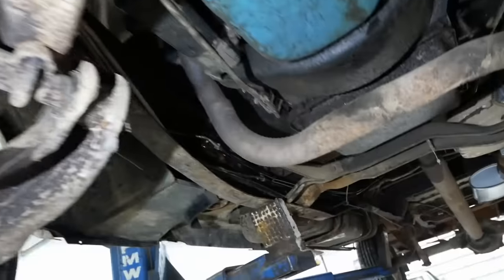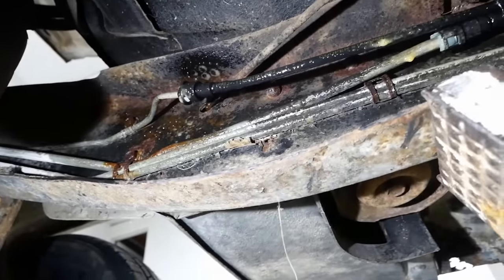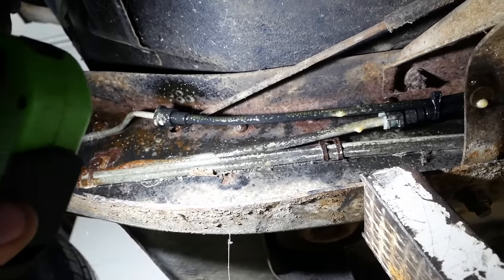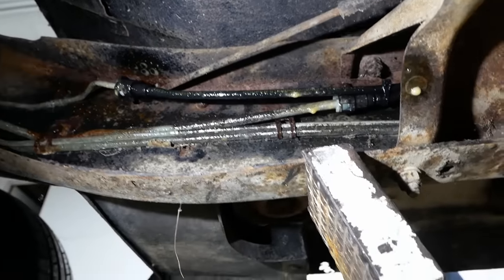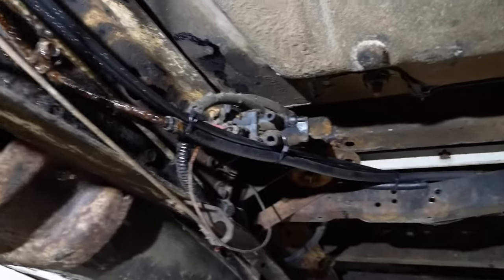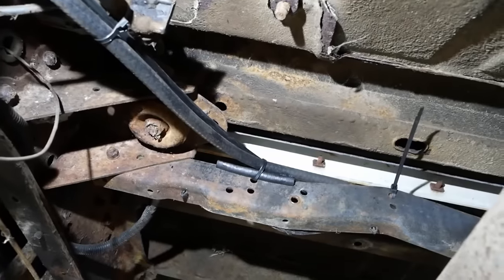Anyway, I'm pretty happy with our repair. The lines from this point forward look fine. But I mean, that's only about 3 feet of line, so we didn't save ourselves a whole lot. If you didn't follow what I was doing, I just formed a quick disconnect end on the steel line, and then I could clip on this plastic or nylon fuel line. It's probably overkill for this application. There's no pressure, but that's my preferred method. And then I just use the hose for the evap line because who cares?